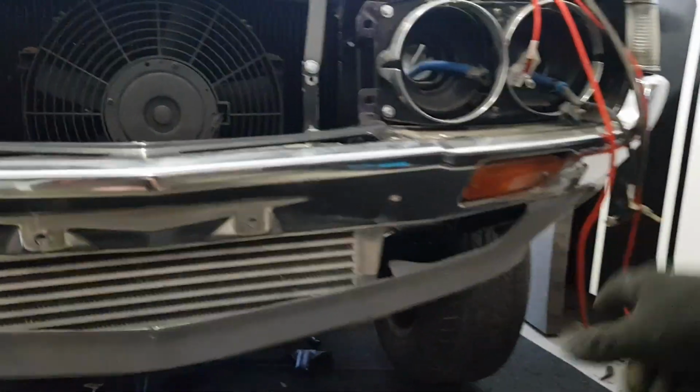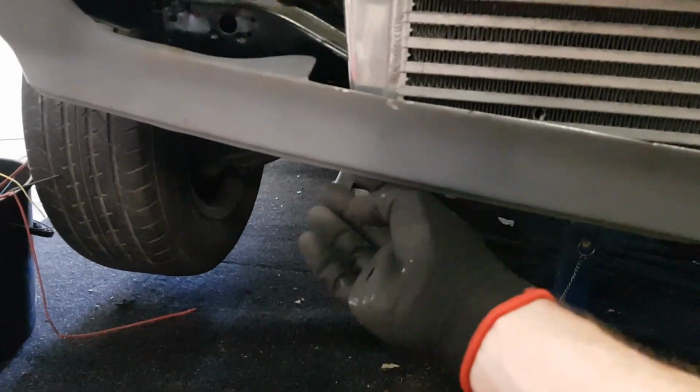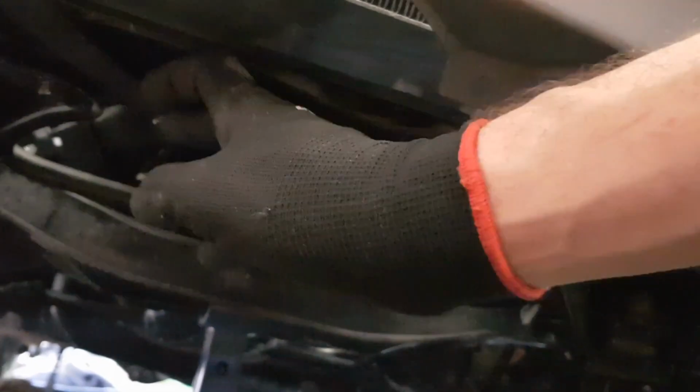That's cool. When that other bolt's on, that's going to be really tight. This just sits where my finger's touching underneath the radiator, underneath the intercooler support. So that's really cool. There is a little tiny tab under. Oh, I just stopped recording accidentally. There's a little tiny tab just here, which begs to be bolted to something. I think just for the sake of it being in place, I can easily run another piece of steel from there to there and just self-tap that straight into the bottom of that plate there, and that'll hold even the front chin spoiler in place.